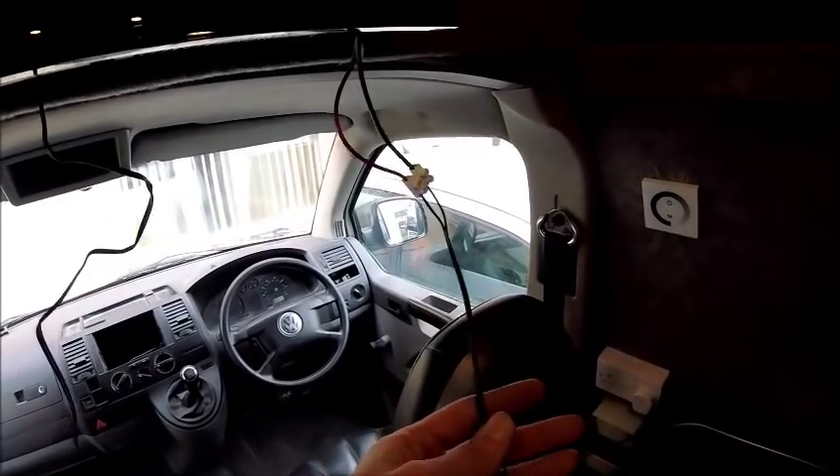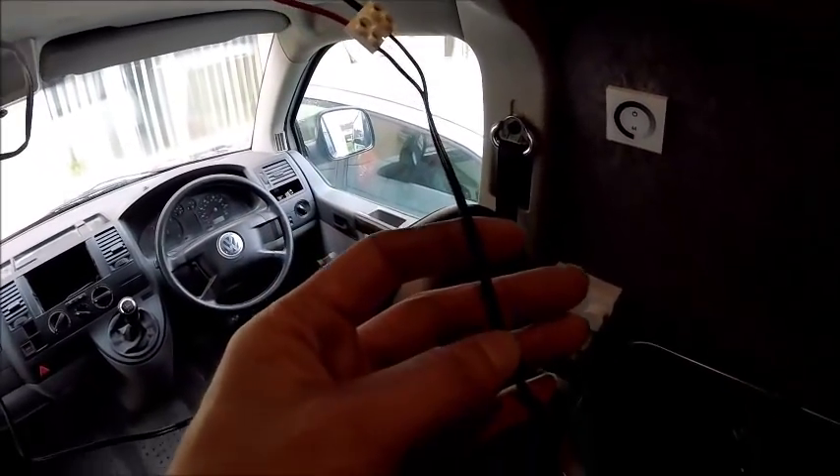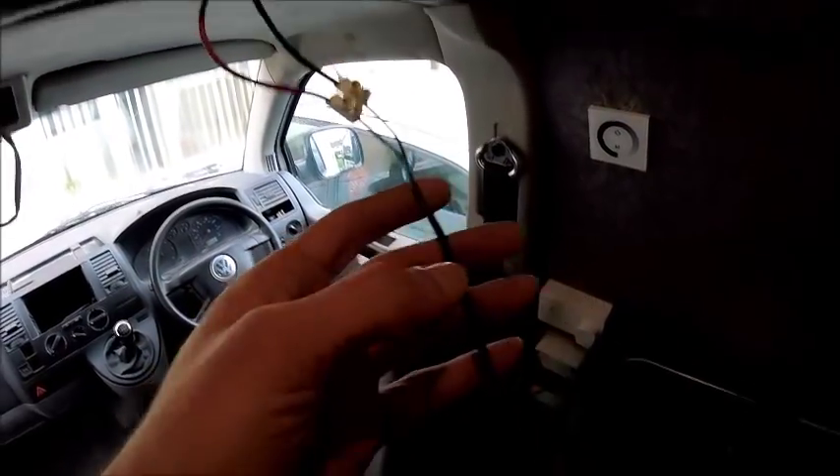So that's the wiring for the TV all in place. On the cable coming from the TV itself, the positive is the cable with the dashed lines on it, and the one with the writing on is the negative. I've got the cabling coming through a little hole just on the back of the unit. I'm going to grind those little screws back off just to make sure they're not going to be stabbing any heads. Then it's just going to be plugging straight into the back of the TV, so there won't be any cables trailing or on show. This cable is then going to get tacked up along the actual lid itself and all the way along there and back down where it's fed in inside, so you shouldn't be able to see anything.